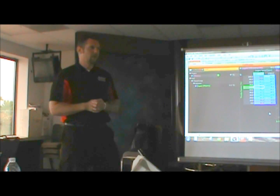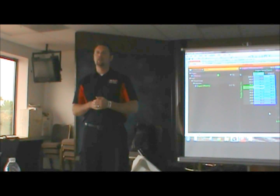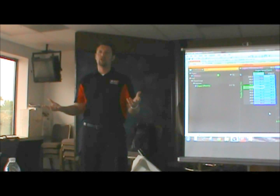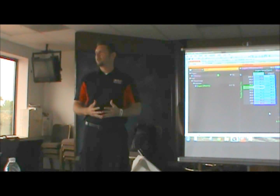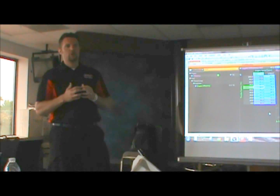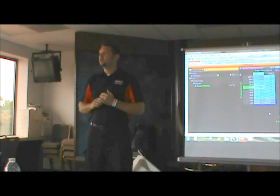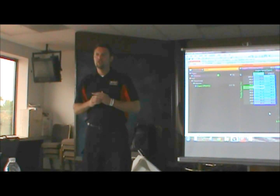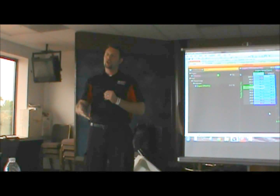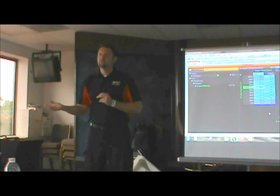That being said, the appropriate strategy is to put it on a dyno and map it for the characteristics of your engine. The cool thing about a fuel model is you really only need to do it once. If you go to the racetrack and you change fuels, you run out of whatever you've got and buy whatever somebody else has, you just need to tell the ECU what kind of fuel you put in it, and then it'll make the appropriate adjustments.